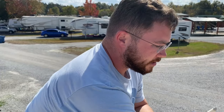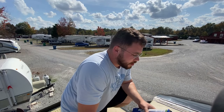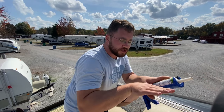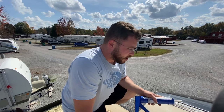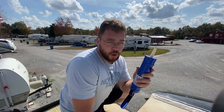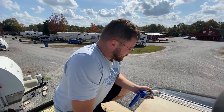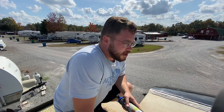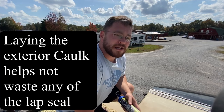Now that the edge of the rail is done where the roof meets the end cap, go through and do a skim coat over the whole top of the rail so that it will self-level and cover everything we need covered, so that we don't get any water where the roof meets the end cap. You are going to go through a lot of this lap sealant and it is expensive. For this, you're probably going to use two or three tubes, so just be prepared — it's about $14 a piece, so it's going to be a little pricey.